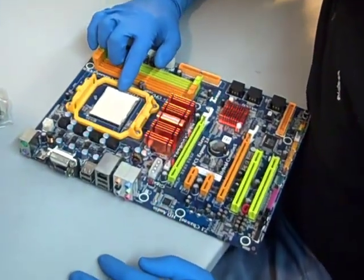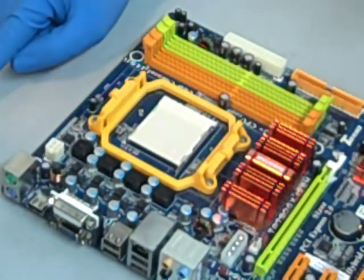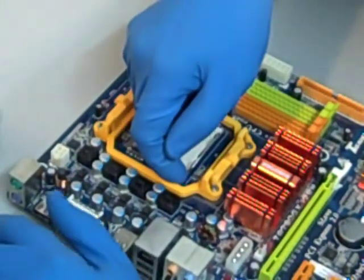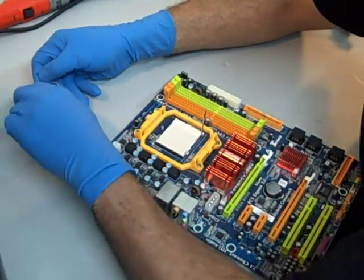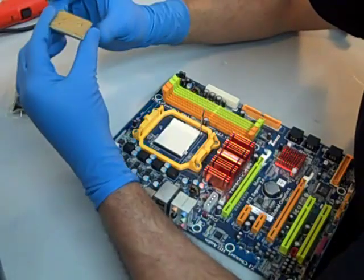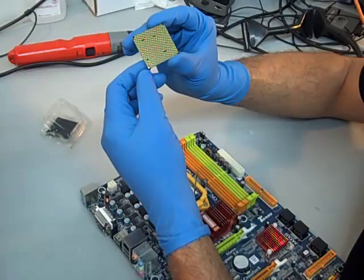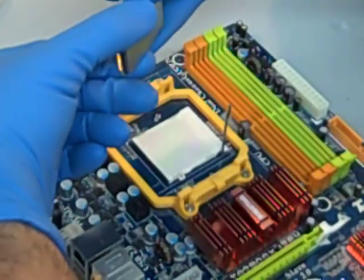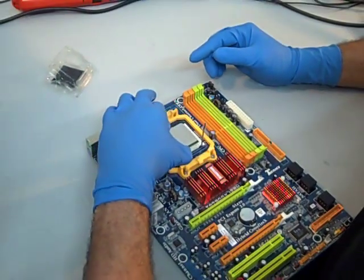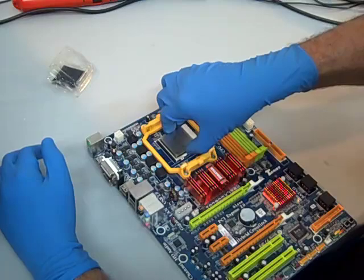This socket is going to be a little bit different. Whereas the other one had two-slot alignment, this one has an arrow alignment, and that arrow on the socket is going to match up to the arrow on the CPU, showing you which way to go. You're going to release the CPU lever and align the arrow up with the arrow on the CPU socket. You can see the arrow down in the corner — that arrow lines up exactly with the arrow on the CPU socket. Take the CPU and hold it directly over the CPU socket, align it up, and drop it straight down into the socket.